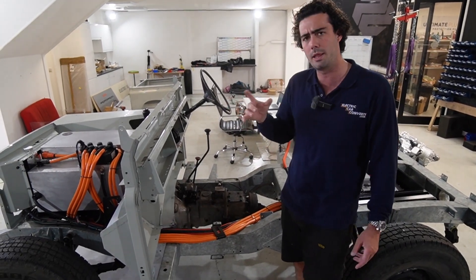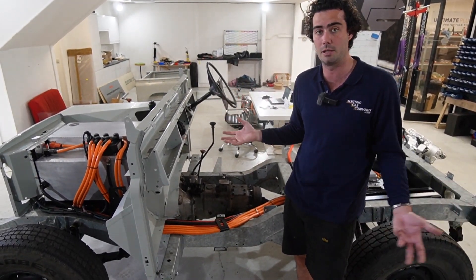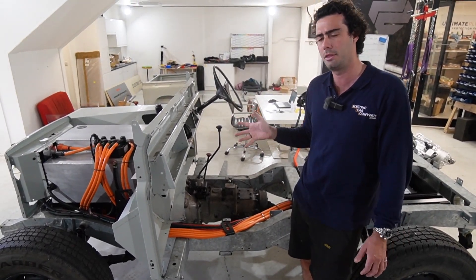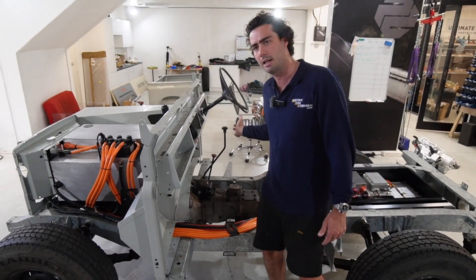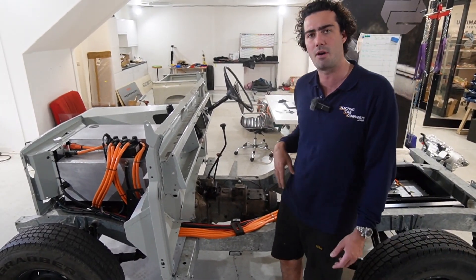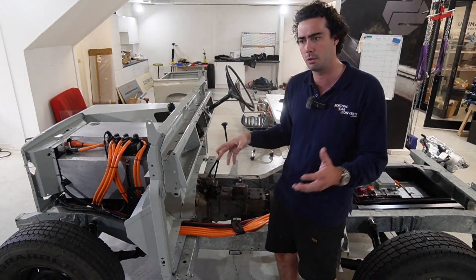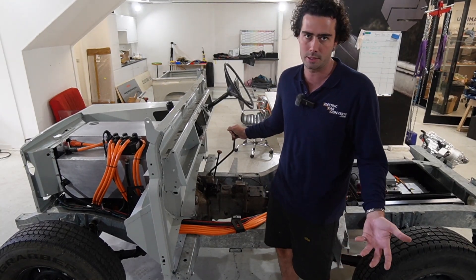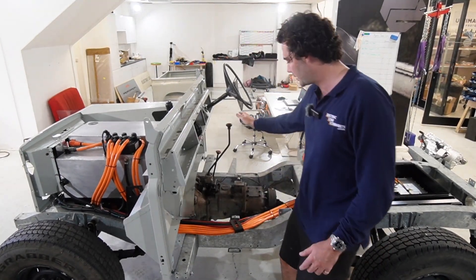This was one of the main questions from clients at Goodwood: why do you still need to change gear in an electric car? The answer is, you don't. You just stick it in third and leave it there 99% of the time. But for the odd farmer, or somebody who wants to go off-road, you can change gear into second and have loads more torque, etc. So that's the gearbox.